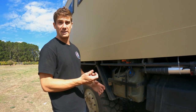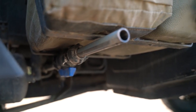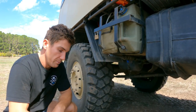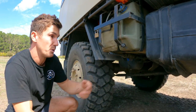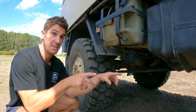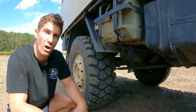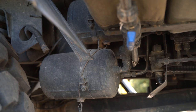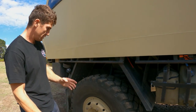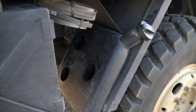Under the air compressor is a ball valve where we release all our gray water. We use biodegradable soaps so we can empty gray water in the bush. We normally have it open so it doesn't smell or become black water after a few days. We have two 40-litre tanks under the tray for gray water storage - so far that's been ample. We didn't want to carry a lot of dirty water around. We also have two more stock air tanks for the rear and all ancillary equipment.